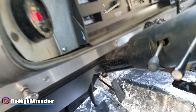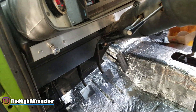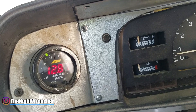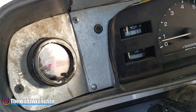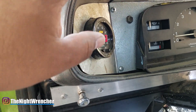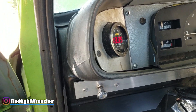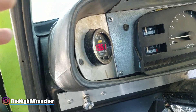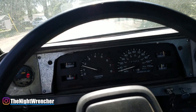It needed a little more fuel to start. After a couple of attempts, it fired up and we were idling. One thing to note: when a carburetor is cold it tends to run rich, and as it heats up it wants to lean out. The only reason I adjusted the idle now is to get it started. Once we get it on the road, warmed up, and heat-soaked, we'll go ahead and dial in the idle properly.